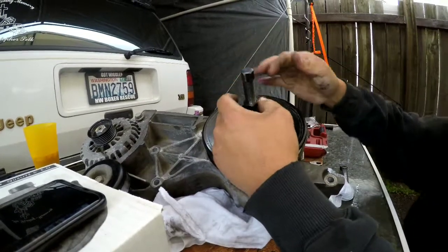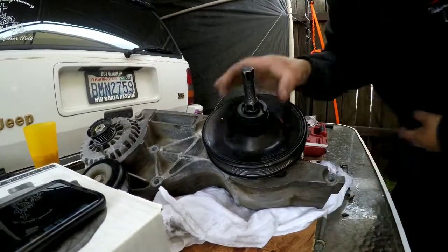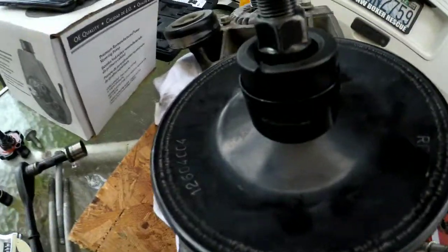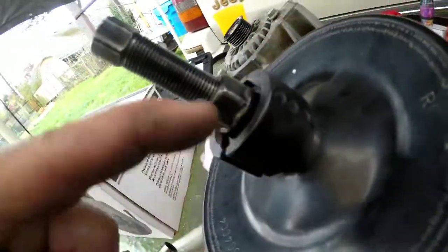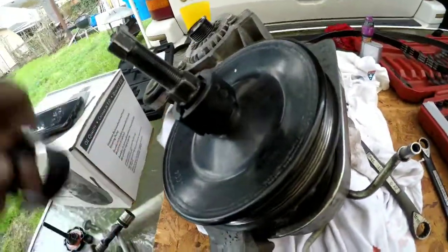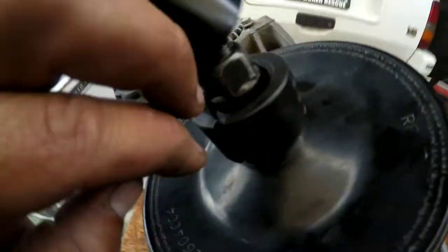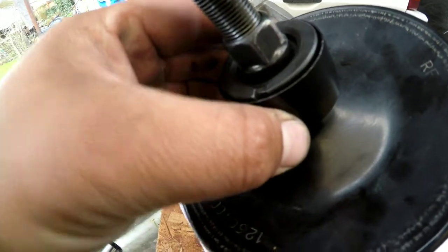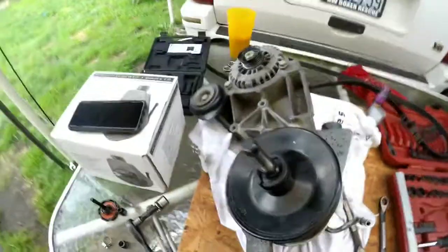Alrighty. So that's just gonna kind of sit there, but you're definitely gonna want to hold it around it. This is just so you guys can get a better idea. These two couplers are underneath the lip of the pulley, because when you tighten this down, it's going to push down on that center part of the pump, which is going to pull this off of it. And then once you get these two little coupler things on there, this is going to slide over, and that's just to hold them together so they don't spread right out on you. So yeah, then you're just going to crank down on this and it's going to pull it off.